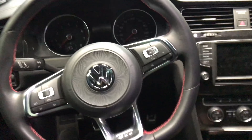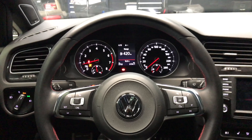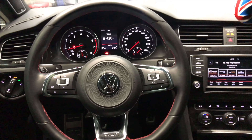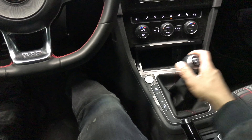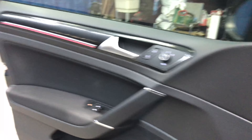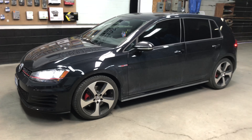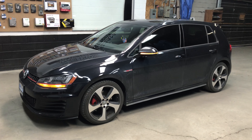So what you need to do — let's go ahead and start the vehicle. Your vehicle has started, and let's just pretend we're parking up now and we're ready to leave the vehicle. First make sure your vehicle is not in gear, so vehicle is in neutral. Pull up your handbrake, let go of the foot brake, we exit the vehicle, close the door, and then within three to four seconds the vehicle will shut down. There you go, now your vehicle is safe to remote start.